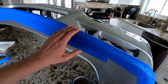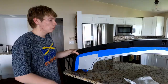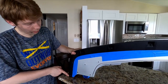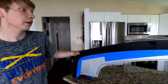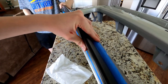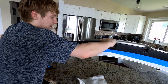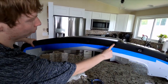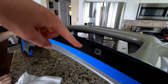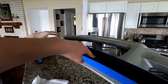We've now taped up the bumper and we're going to mock up the splitter. This is how it's going to sit when it's on the car — you can see the drill points we need to mark. When marking, you want to make sure the splitter is flush up against it, because if you let it drop it's going to fall and you'll mark it wrong. Snug it up, mark properly, and since these go in at an angle, mark and drill at an angle.